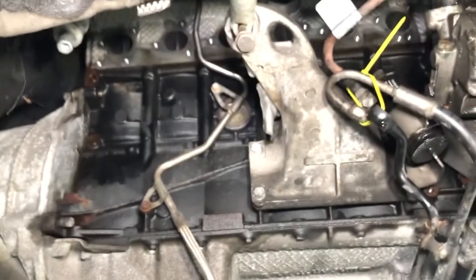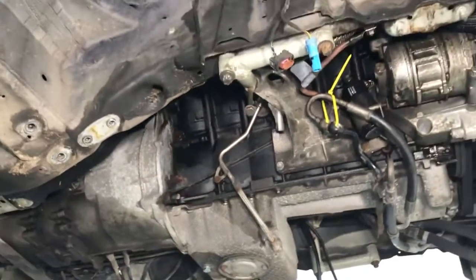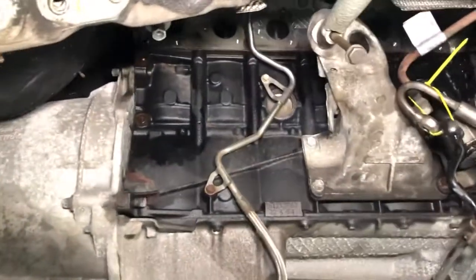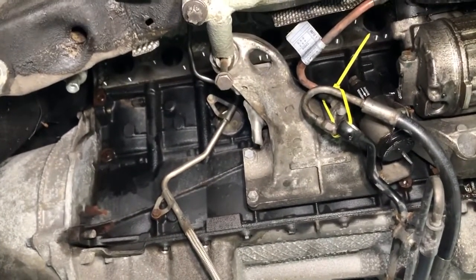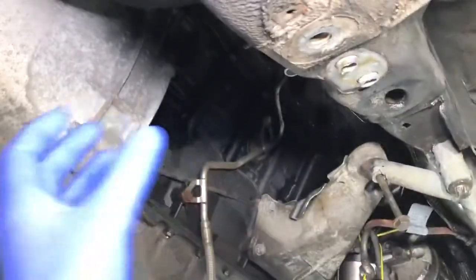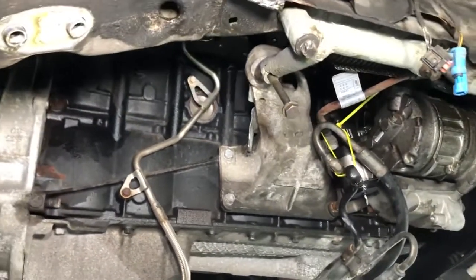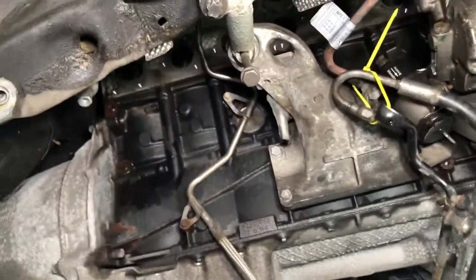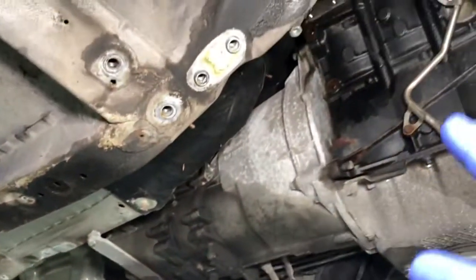And eagle-eye viewers would have noticed that the engine is looking quite bare as well, because there's no exhaust manifold on there. So because it's a full underside restoration and a very extensive one at that, that nowadays really needs to include the exhaust manifold. As the exhausts get a little bit older, they do get relatively corroded. It's only external corrosion, but we also do see some of them at the downpipe flange, which lives about here, two of them. One of the sides sometimes cracks all the way around, so we always like to take those off and give them a thorough inspection, and whilst they're off, they're obviously going to be plasma coated as well, very similar to the rear center cats, the center silencer and then the rear silencer. We want that to match.